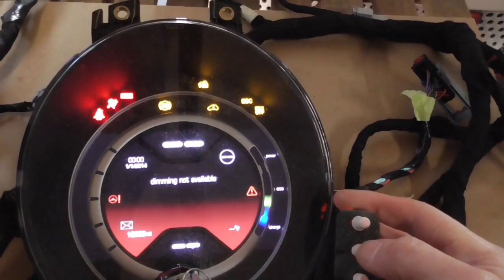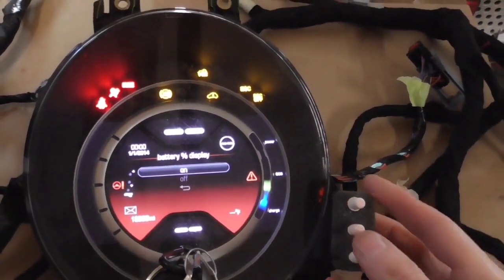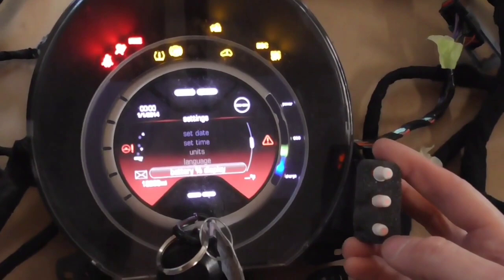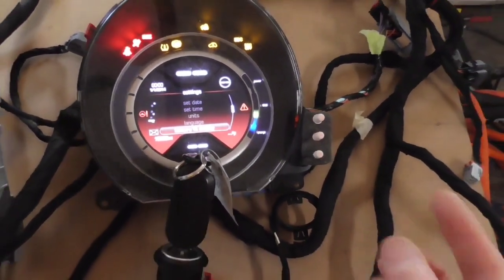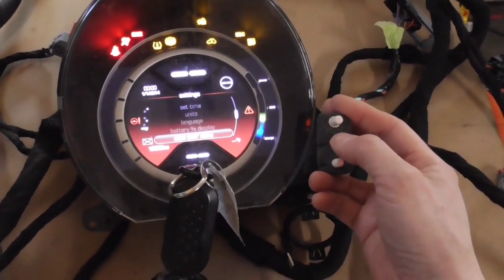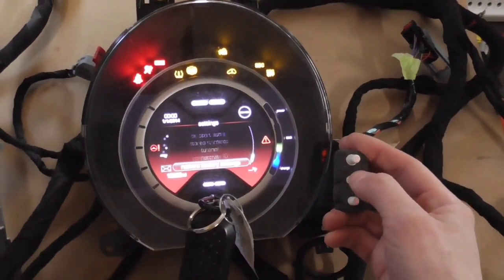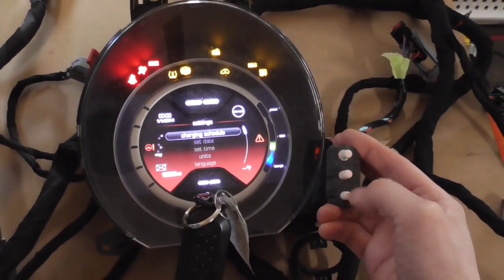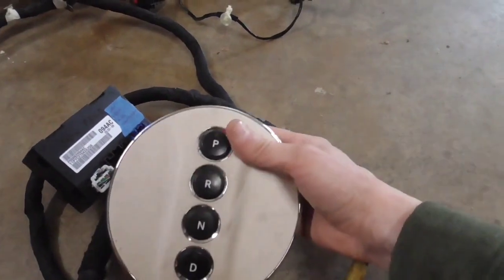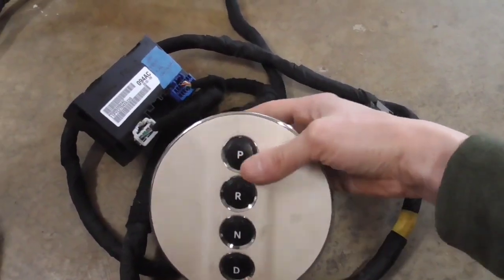We do have power, of course. We're not getting any battery state of charge indication on the display — there's nothing showing the battery as if it's not even connected, and yet it is. I also don't have the column stalk button connected to switch our menu, which is going to be a pain to track down. All kinds of issues. When we boot it up, the charging port display doesn't even have any illumination, which leads me to believe it's not connected. There's a module right here that goes into there.